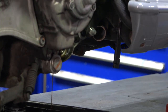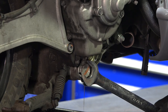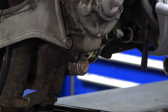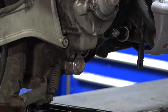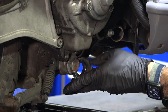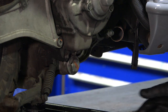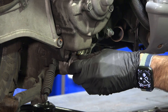Once the filter is off and draining a bit, you can get easy access to your drain plug. You can use a 24mm combination wrench — be careful not to skin your knuckles — or a large shallow 24mm socket, which makes it really easy especially when the muffler is in place. Take care to get the wrench fully seated and just push to crack it free. If you have to really strain, it was over-tightened last time — it doesn't need to be that tight, it's just sealing a gasket.